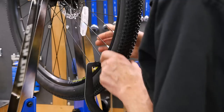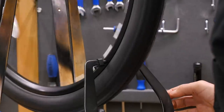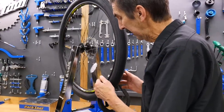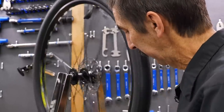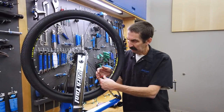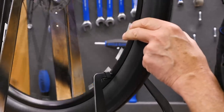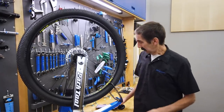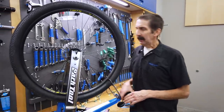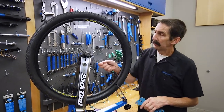On the front wheel — a little tighten and a little loosen on the spoke nipples. Since this is a disc brake bike and not a rim brake, we don't need it perfect, but we don't want it hitting the fork and we want it to look good for Pat. That's looking pretty good. A spoke tensiometer can give us a deflection reading — we can check our chart to determine how tight the spokes really are.